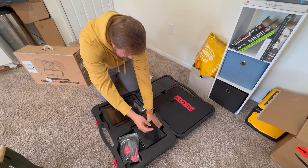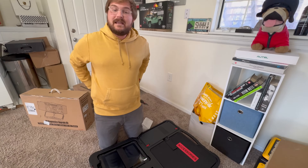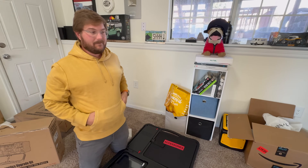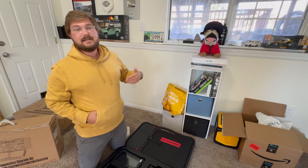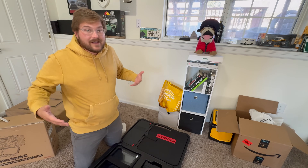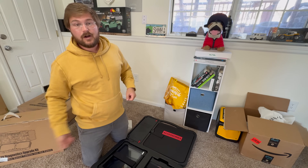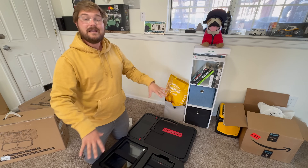I actually think this would have been really cool — for those who haven't seen the Out of Spec Reviews video — I just bought a Mercedes B-Class electric that has some problems. In the video I said it had an onboard charger problem, but it turns out the onboard charger is fine. It's actually a problem with the DC-to-DC converter that the previous owner paid like $7,000 to Mercedes to fix. My guess is they didn't fix it properly, and then the car wouldn't charge and became a brick. We could have found all of that out pre-purchase if I'd just brought this kit.